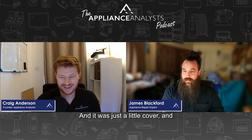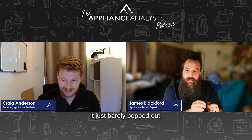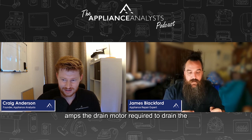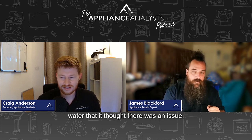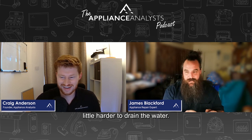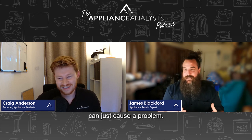And it was just a little cover, just a centimeter askew. It just barely popped out. But when it did that, it changed how many amps the drain motor required to drain the water, so it thought there was an issue. Wow. Just because it had to try a little harder to drain the water. That's an example where a little too much technology can cause a really big problem.